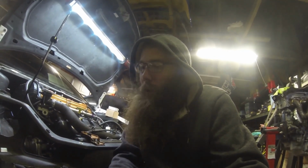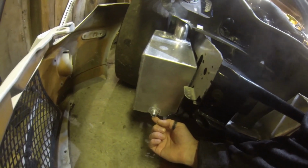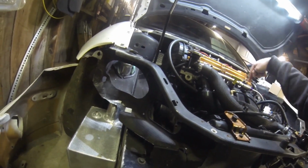So he had one that was all mocked up. He didn't have any tabs or anything on it yet. So he went ahead and he moved the mounting locations. So we got a dash 10 coming out of the bottom of the cell here, dash 6 return. What we're going to end up doing is I'm going to get rid of the return rail here.